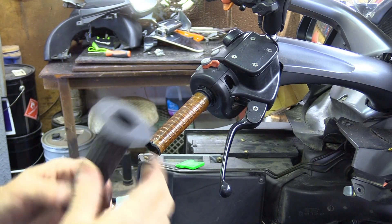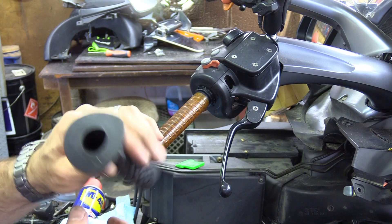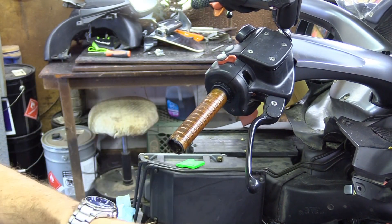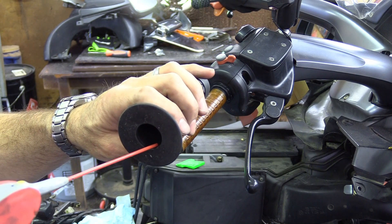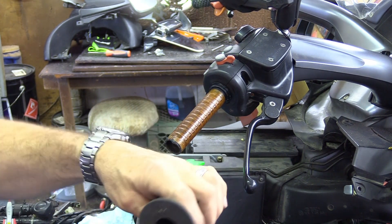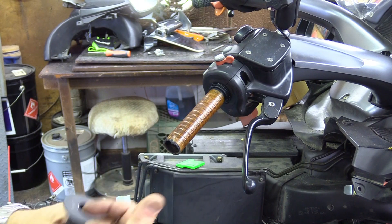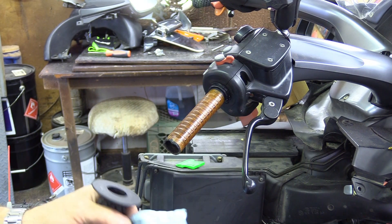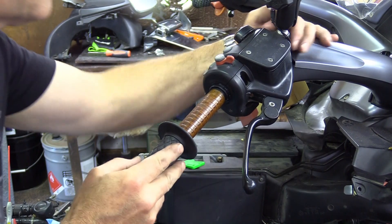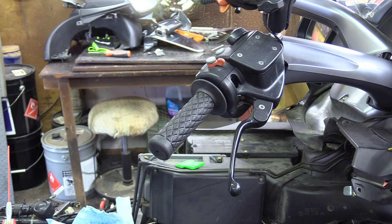Last tip before I install this: it does help a little bit if you heat these up. Set them out in the sun or use a hair dryer — don't get them so hot that you melt them, they just need to be pliable so it slides on easy. And if you really want to try to get that three-quarter-inch side on, go right ahead, but it's a lot easier to just install two sets. They are not expensive — you're looking at forty dollars total to replace your grips versus almost three hundred dollars that BMW wants for a full set. No thanks — I'll gladly pay the forty bucks. That's it, all done. Thanks for watching guys, see you in the next one.